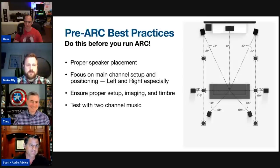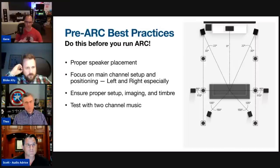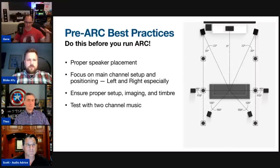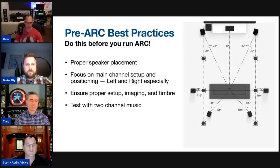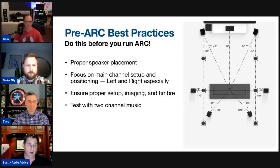For the side and back channels in immersive audio, you want your bed layers at ear level for better separation with heights. But because theater chairs absorb too much from behind, I like to have the tweeter maybe a foot or two above seated ear level to help offset that. Our home theater design tool similarly pushes the tweeter just above the average home theater chair and moves side speakers slightly forward.